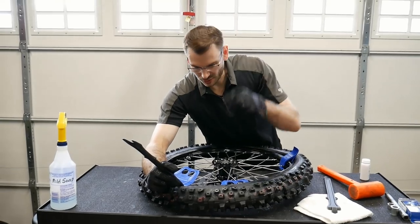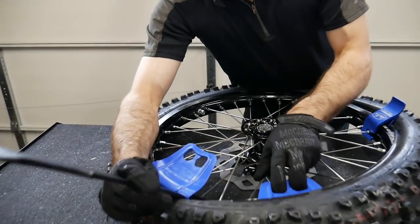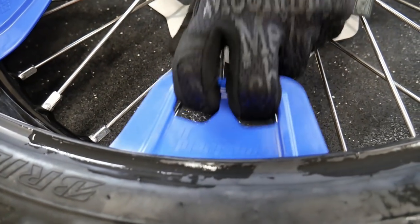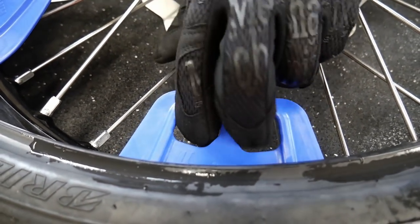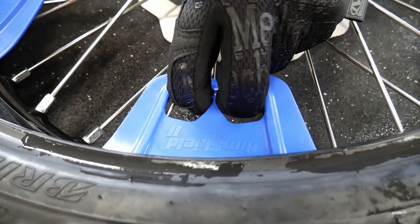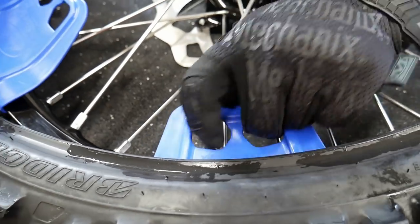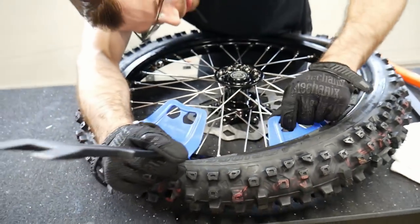Okay, so see this here where the rim shield is, it keeps getting sucked in to the rim. That's telling me that it's got a hold of the tube. It's like pinching a portion of the tube. And so the tube is actually underneath, and then whenever I let go, it inflates. And so what you have to do is you have to be very careful.